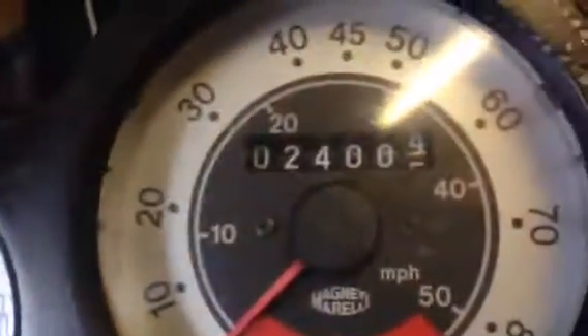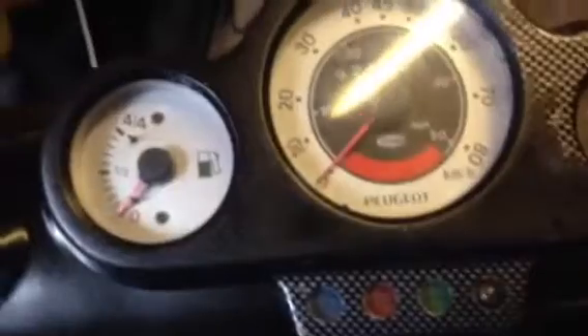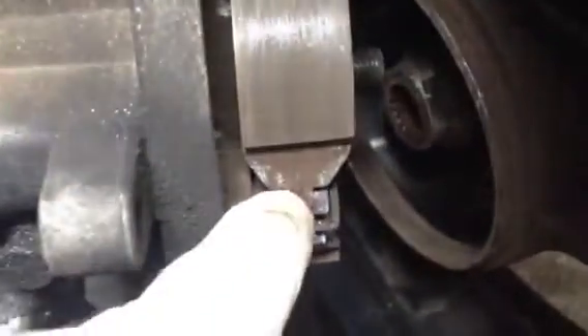Just a little over 15 miles on the bike now. Someone mentioned the back wheel - I noticed it actually when I was coming to the garage. I'll take the back wheel off - there's the mechanism and it's a little bit stuck, so I'm going to grease and spray all that up, not the pads obviously. Job done - 15 miles, she started and stopped, happily does 30 to 40 miles an hour on the flat and 45 downhill.